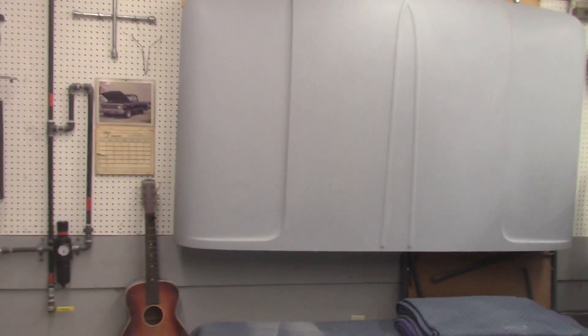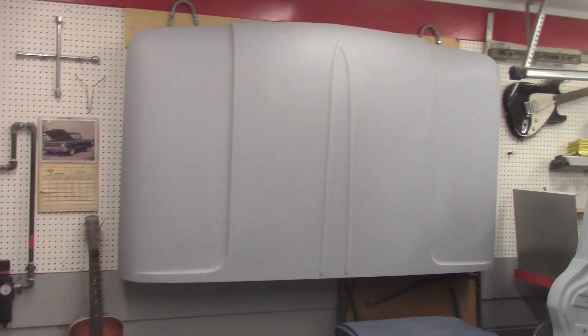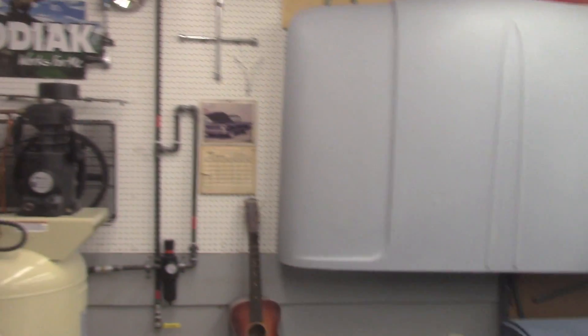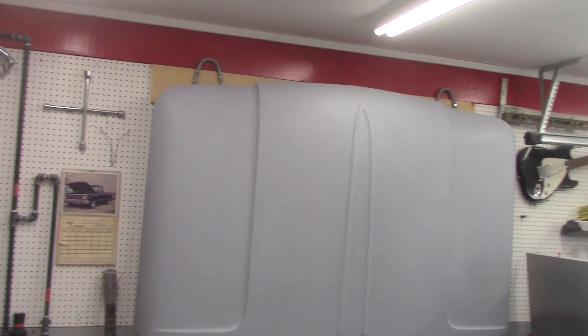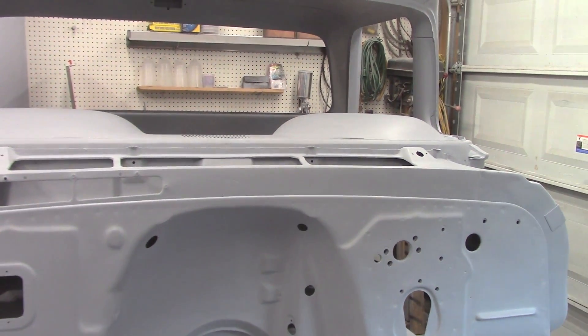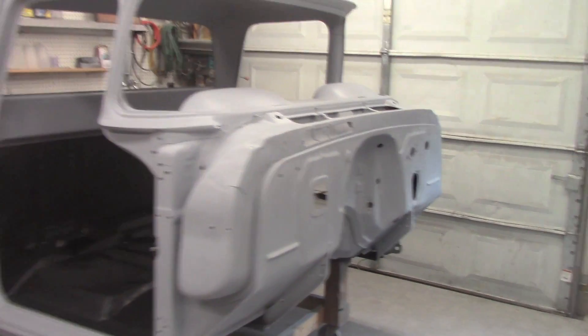Hood's all sanded down to 400 — I gotta hit it again with some 500. Turned out pretty good. I still got a low spot here and there, got a full-width low spot somewhere in here. Gotta get that sanded down to 500 and be done with that. Got it hung up there — gonna put some plastic over it before I start doing more work and sanding. Still looking for a gun — I gotta get a spray gun. Looking at what I think is called HVLP or LVLP — help me out, I still gotta find a gun.